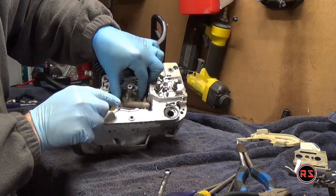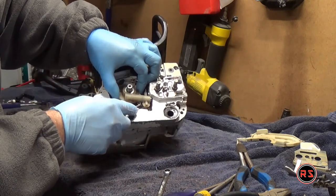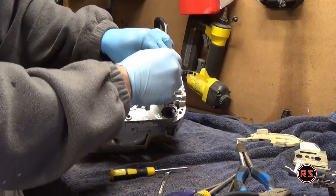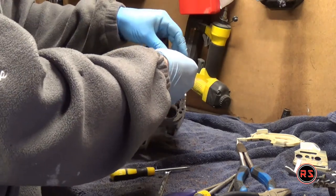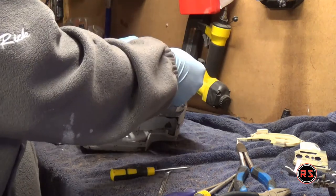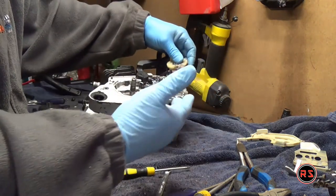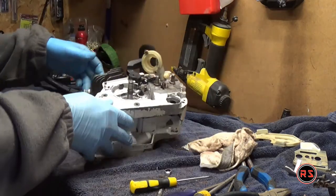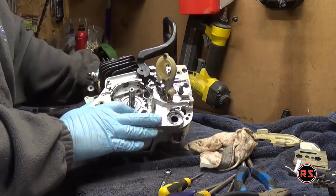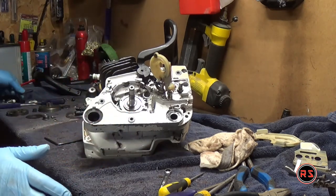As you can see, the oil pump is just sitting on the oil line. The oil line was dry and cracked — that's why the oil was leaking between the oil line and the oil pump, which is why I needed to replace it. I find it a pretty awkward design — if it was a line fit like a fuel line on a carburetor, there would be no oil leak like in my case. I feel like it's a weird design that could be improved by simply connecting the hose directly to the oil pump instead of having it sit on the line.